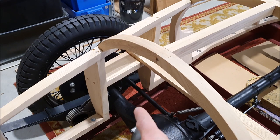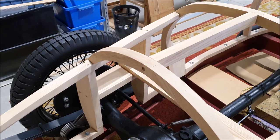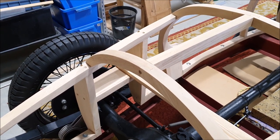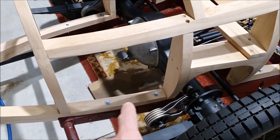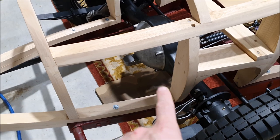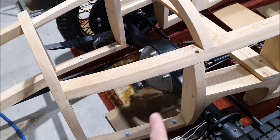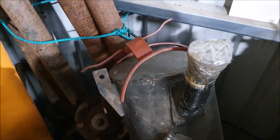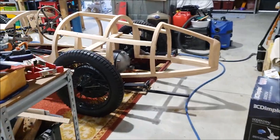I need to make the hoops that go over the axle — they work kind of as rebound straps to stop the axle coming too high up, so I need to make those out of some metal strap. There will be other brackets and bits and pieces. I'm hoping to reuse these mounting bolts here to make up the cradle that will hold the fuel tank. The fuel tanks on these are round — it's a circular tank, actually original, a saloon car tank — just a cylinder soldered together, so the tank will go in there.